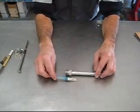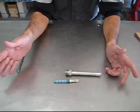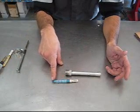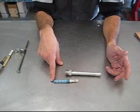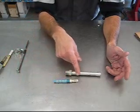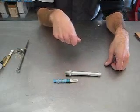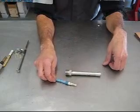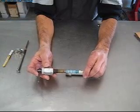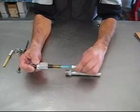They need to be put in properly. Rules of thumb: the flow of the system will always be from the condenser to the evaporator. The long side of the screen needs to face the incoming refrigerant. So as it comes out of the condenser, it goes through the orifice tube into the evaporator — long screen will always be out. The other way to tell is that there are two little tabs on here, which are designed for an orifice tube extractor to attach to and pull it out. So that's another clue.